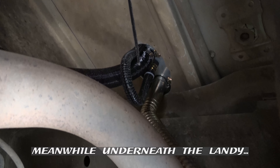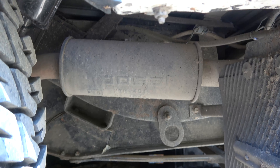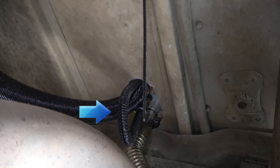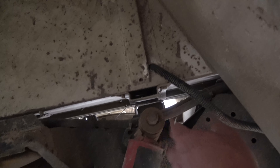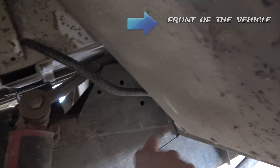Here we have the exhaust and the inlet for the air to the combustion chamber. The exhaust comes around into the wheel well — I've just hooked it up here. I'm not too worried about the heat because we already have an exhaust right here. I've also looped the diesel pipe down and back into the car, running through the boxes all the way to the right-hand side rear wheel arch.